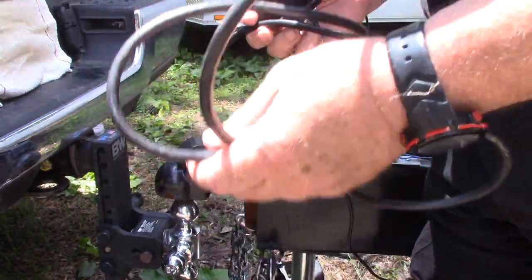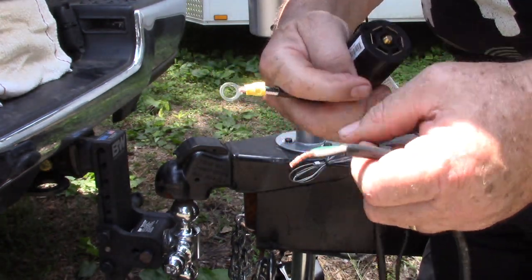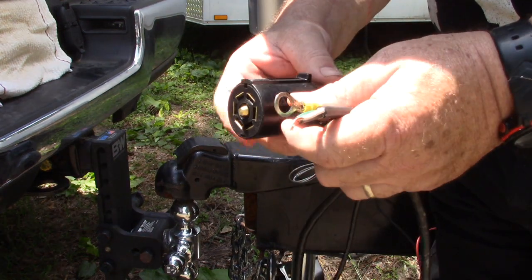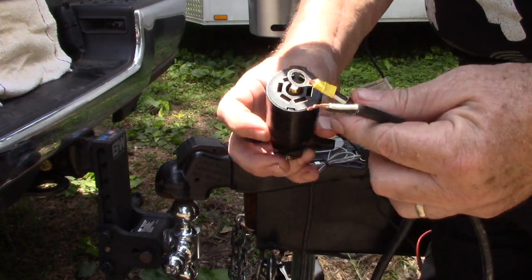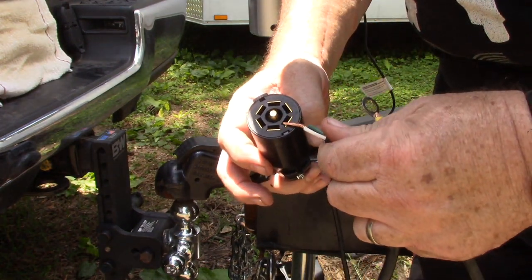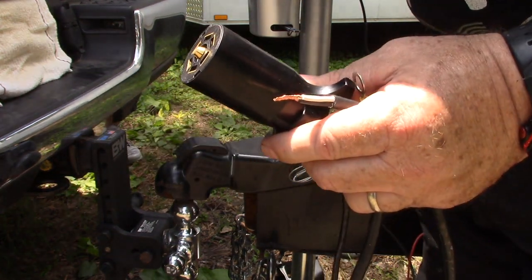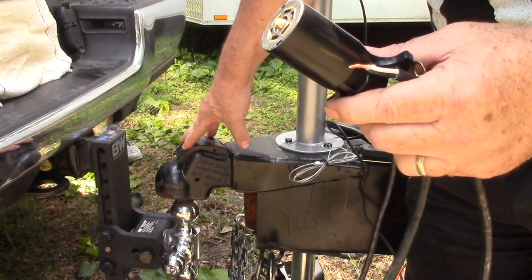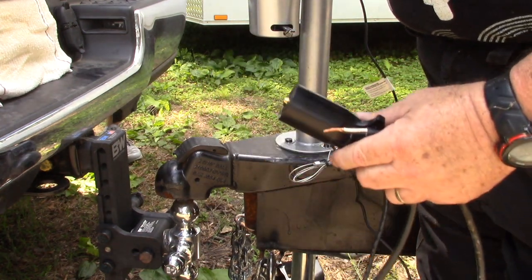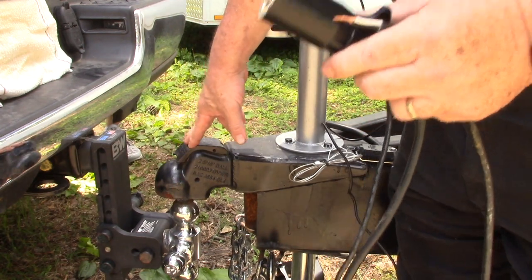So we got a cord here from an old freezer that didn't work — I just stripped all three wires and twisted them together. On this end we put a connector that will go around the bolt on the bottom of the jack. This end here is going to go on the pin opposite the 12 volts. I believe this pin here is the 12 volt pin, so the pin over here is the ground pin — that's where this wire will go. Then we'll hook it up again and see if it goes up and down. That will cure the problem of not having ground as soon as the hitch clears the ball, and maybe fix the intermittent problem too.